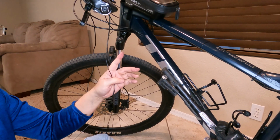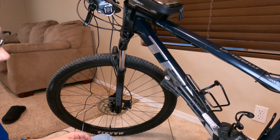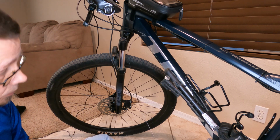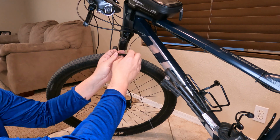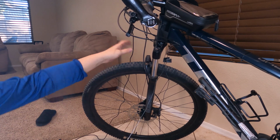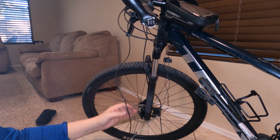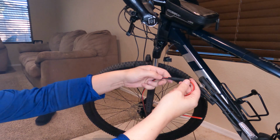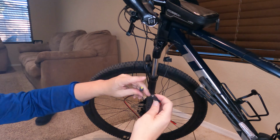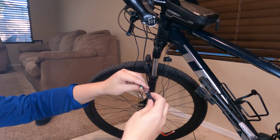Okay, now I just got to do one more wire in that same spot, which is a little bit tighter, and it'll be ready. Now that I have the one wire in there though, I'm going to add a piece of tape to both ends so I can mark the difference between the two. Okay, now that second wire is in, now I can go ahead and shorten this and make a connector for it. For this upper connection, I'm going to use some bullet connectors. It's low voltage, should work out well for it, and it does protect the one polarity from getting wet, which pretty much makes it water resistant.